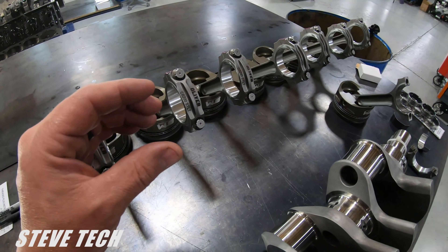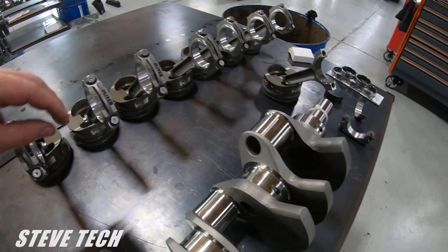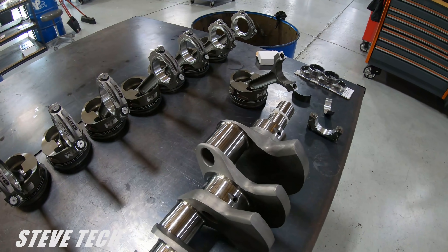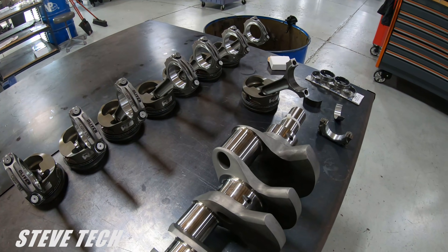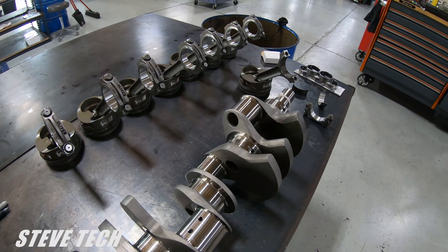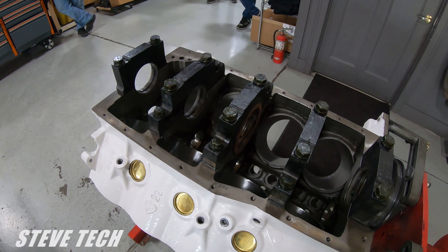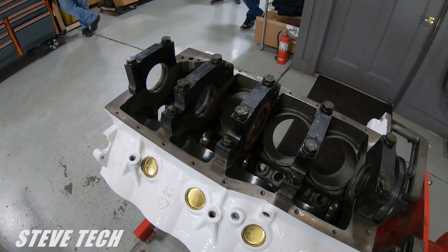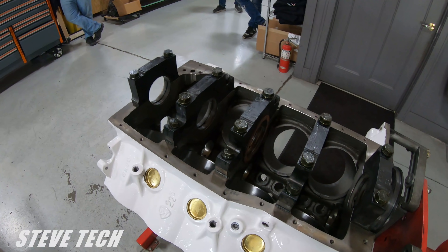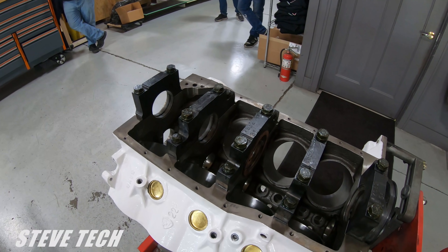We don't want to get real tight because as you get really tight on the bearing clearances, it makes excessive heat in the oil. We want flow — the flow through the bearing, the flow through the sides is what cools the oil. Oil going through it makes it cool. So there's a balance there, but in general on a steel rod you're going to be at two to two and a half thousandths. Mains, you're going to be at two and a half to three. That's a good general deal. Pro modified stuff, they get real crazy and we'll get big clearances up in that six to seven range — I've even seen stuff that was upwards of eight. This is the proper way of checking your clearances — these are clearances that you need in general for all applications. Stay tuned for other videos, and if you have any suggestions of other things you want to see, you can get a hold of us at Steve Morris Engines. If you're a subscriber, we're more than happy to do some different tech-oriented videos just for you.